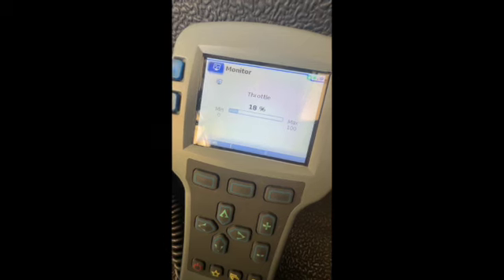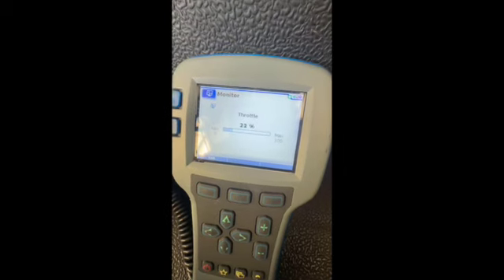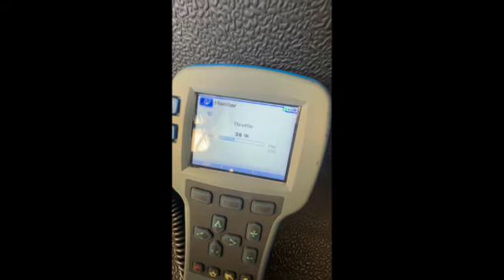There goes a little bit of jump right there — that's about a third throttle, and that's where most people are cruising around, around a third to half throttle. As I go down all the way, it's still bouncing around. About two-thirds throttle — as you can see I'm not getting a clean two-thirds signal. As I go all the way down, look at that — I'm definitely beyond two-thirds and it's just bouncing.